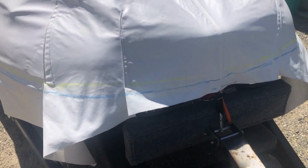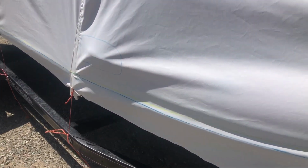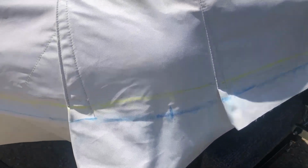We're going to do a 10 inch right here in the front, tapered out to a 6 inch all the way around. And I'll show you how that's going to work. At this point, you just figure out where your boxing is going to go and where your seams are going to be. I've got a seam here, another seam here. That was a mistake. A seam here, and then they go quite a ways apart. 57 inches a seam. A seam, and that will take me around to the back. So I'll pull my cover off and start fitting my boxing.